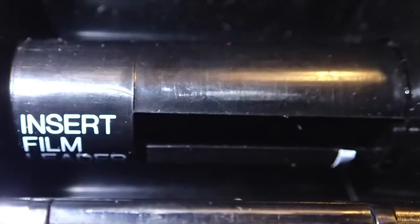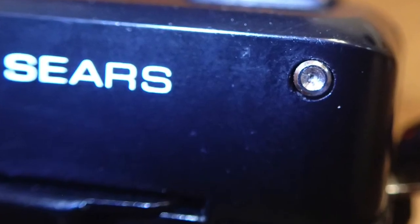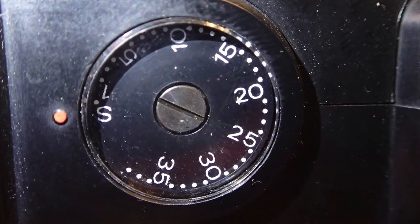It has a motorized wind. It does not auto-load, though — you still have to slip the film into the take-up spool. It does have automatic rewind, where this thing that looks like a rivet or screw head, you can use a ballpoint pen for mid-roll rewind. It takes two AA batteries in the chamber on the bottom, and interestingly, the frame counter is a circular dial on the bottom. Works well, just a little weird to keep flipping the camera over to see where you are on the roll.